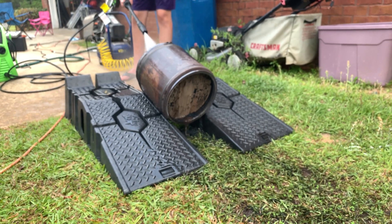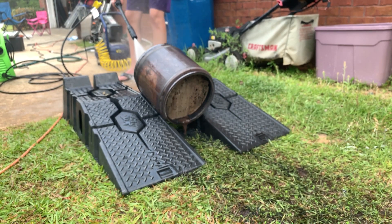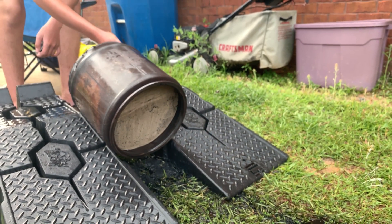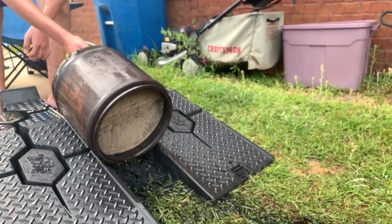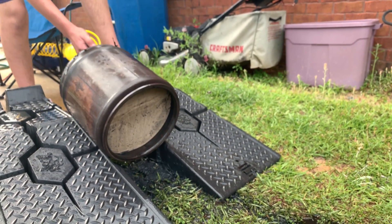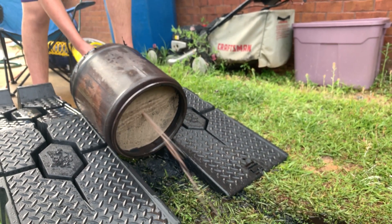What I do is put it in a regular oven at 400 degrees for a couple hours just to dry it out completely before putting them in. And that's it — you've got basically remanufactured DPF filters. Now we're blowing that out with a regular 60 PSI air gun. Once we get all the water out, we repeat with the pressure washer again — about three to four times until you start seeing only clean water. You can stop at that point. You can see it still has color to it; that's ash basically being washed out.